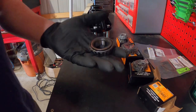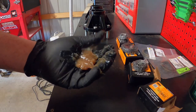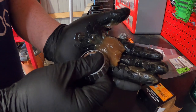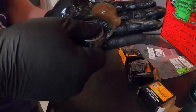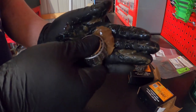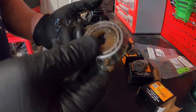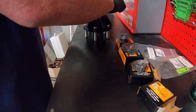Packing wheel bearings. Take your wheel bearing — it's fresh out of the package, no grease on it. You take a blob of grease in your hand, put it in your palm, and you just kind of work it. You smash the bearing down into the grease and into your palm, and you work it until you can see grease coming out the opposite side. Then you slowly move around the bearing until you've coated the whole thing. It's a nice and messy job — you want to make sure you wear gloves, because if you don't, your hands will be a disaster.